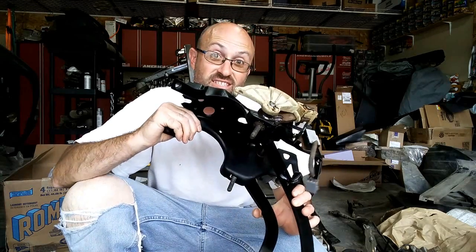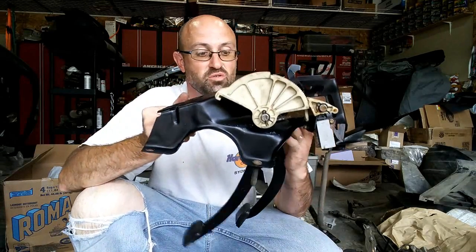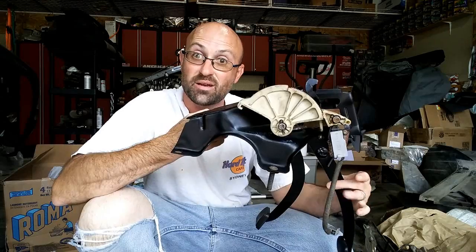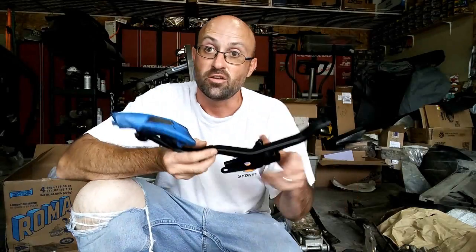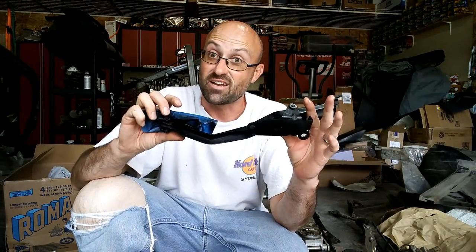With everything fully assembled, it's all back together. When you get this together, you want to make sure that everything moves smoothly back and forth. When it's just dangling that way, you know there's going to be no bind — your brakes will stop and your clutch will disengage when you need it to. You can also do your gas pedal here. I had mine taped up because it doesn't come off very easy from this pin, so that's done also to match.